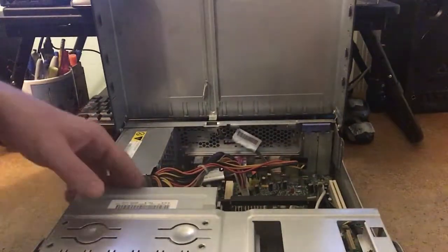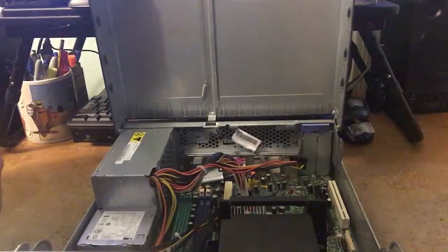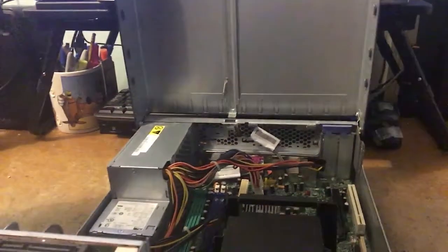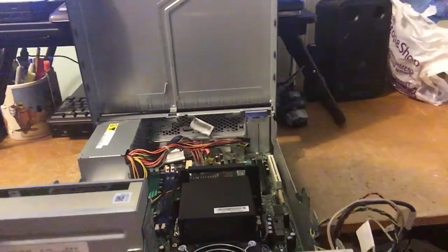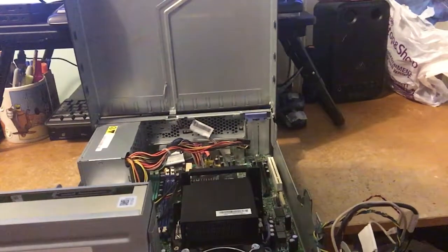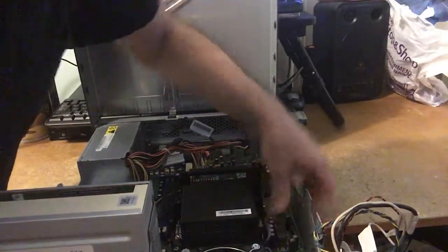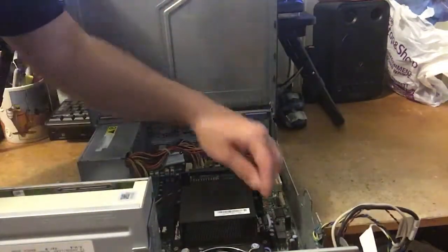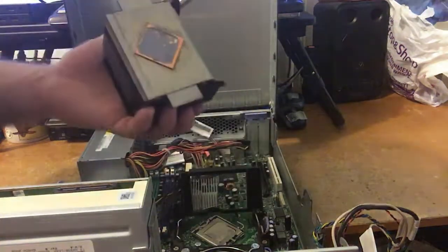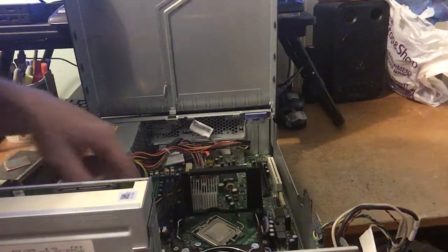You'll see I've kind of gutted it pretty good already — got the hard drive out and taken all the cords out just to make everything easy. What I'm going to do is take off the heat sink. To do that you just push this button and push it the right way — it just pops right off. There we go, just lift it out. I'm going to put some new thermal grease on these too — really got to get some and put some on.